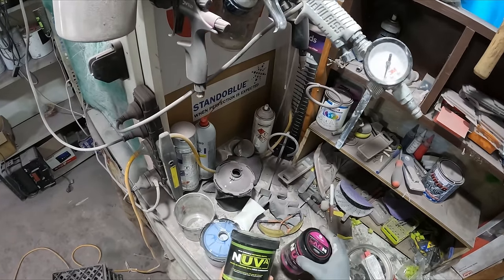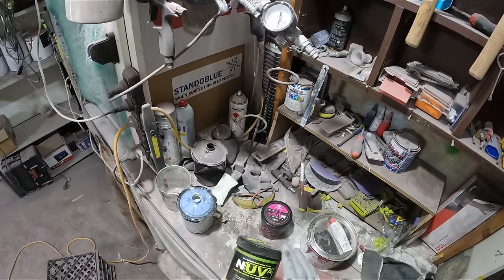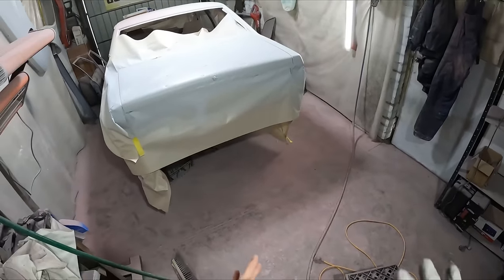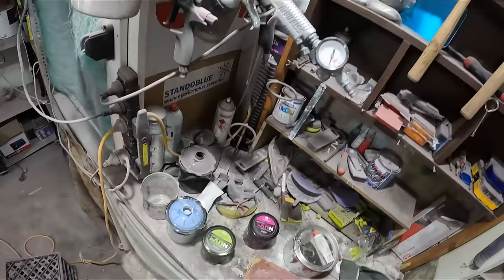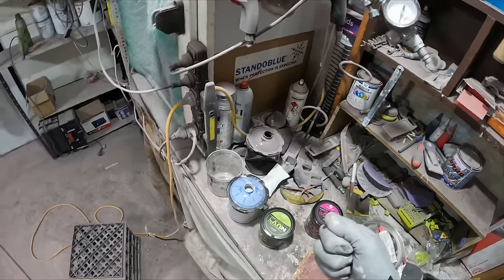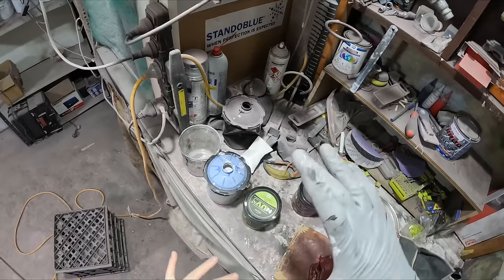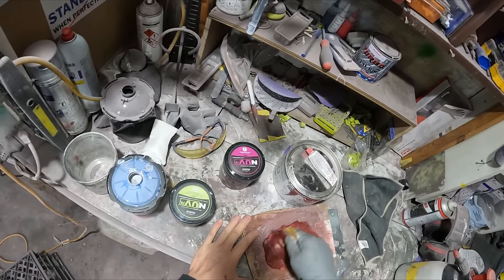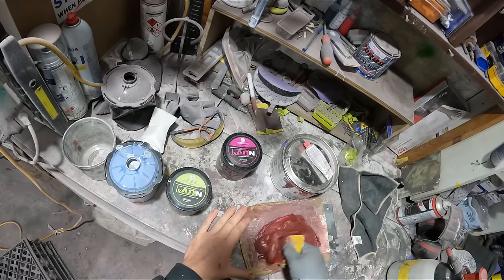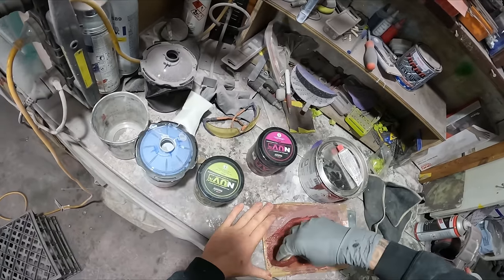With this job I'm just going to do two-pack the whole way through. Part of the reason why UV fillers work so well for what I do at work is because I'm pretty much always working with fully cured two-packs. But here I only put the epoxy on last night, so if I put UV filler on and dried it straight away, the epoxy would still be curing while the UV isn't shrinking — that could lead to some uneven drying. I'd rather put two-pack in so it's all compatible.